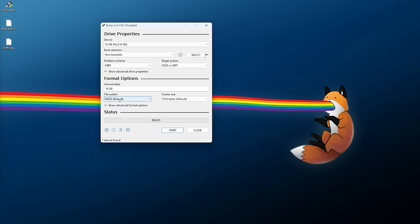To check the file name on Windows, go to View and enable 'Show File Name Extensions.' It should be a .PUP file. If it's a ZIP, 7Z, or RAR archive, use 7-Zip to extract it first. Once you have the PUP file, rename it so it looks exactly like this: PS3UPDAT.PUP. The structure you need is: USB drive root → PS3 folder → UPDATE folder → PS3UPDAT.PUP.